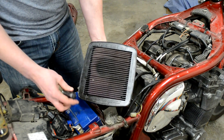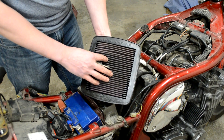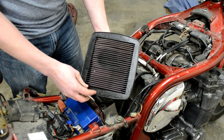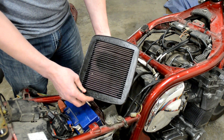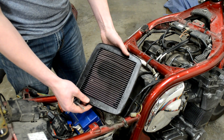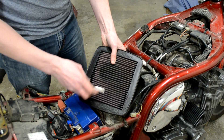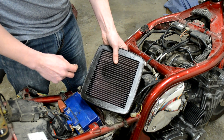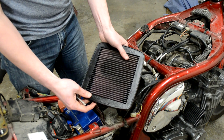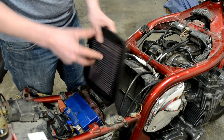The reason I'm showing this video is to drive home the point: if you have one of these air filters and you're not oiling it, after a little bit of riding — and it doesn't take that long — your bike will be running lean. This is especially a concern on carbureted motorcycle engines, or carbureted engines of any kind. As the oil disappears, your bike will run lean, and that will give you the popping and cracking noise you're concerned about. So just keep the filter oiled up.